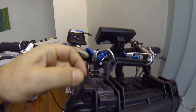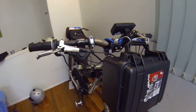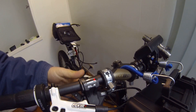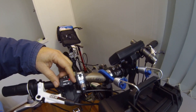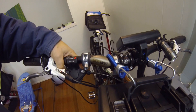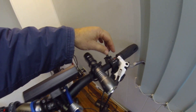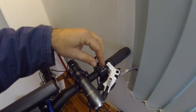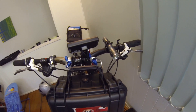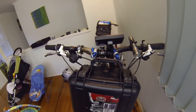I was originally going to use this to put it up, but then I saw there are little holes here in the handle. Anyway, superficial stuff. I will be getting rid of this chunky derailleur, and I've ordered a 7-speed twister for this side. That will free up this terrible space — this cable is really hard to work with. This one I'm going to get rid of, and this lockout I'm going to get rid of. The brake cable is a lot softer. I'll be mounting my lights elsewhere and getting different kinds of lights. The cycle analyst will be going somewhere else as well.